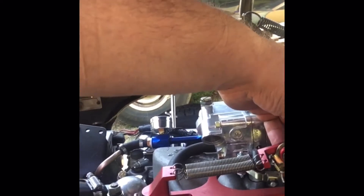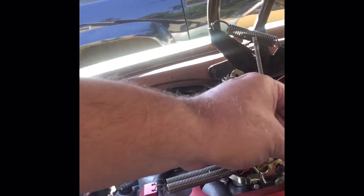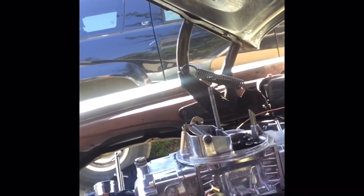It's not on stock, it's something you have to order through their parts — I'll be getting it in about two or three days. This is going to give you a little bit of a look at what I'm doing. I'll be replacing this cable. That was part of the telltale sign this is not the right cable — on the V8 cables that shield is there; this one doesn't have it. I don't know if that's a Corvette cable or a later-style Camaro cable, but that ain't it. I'll be disconnecting this, putting the bolt back on because that's part of the throttle return assembly.